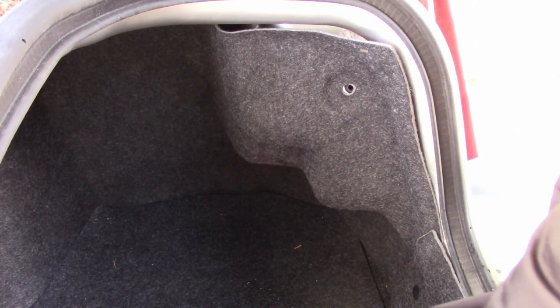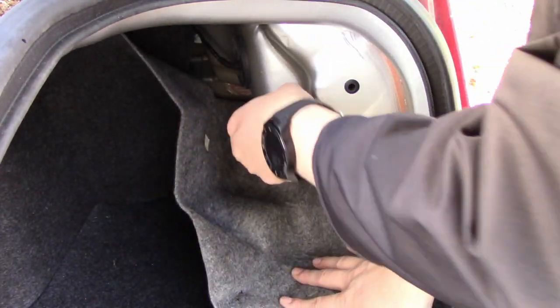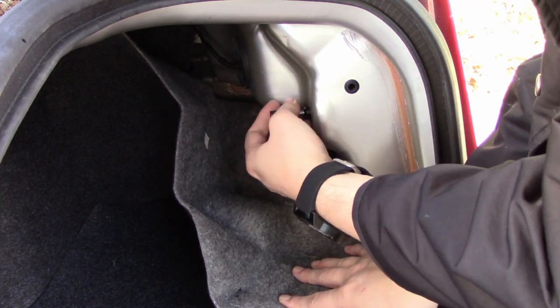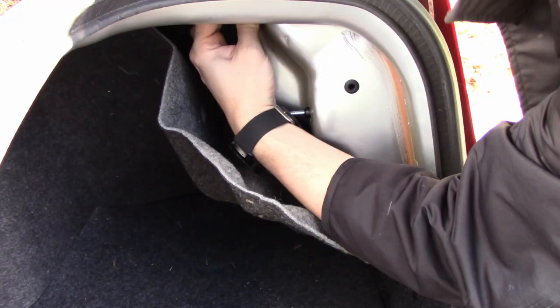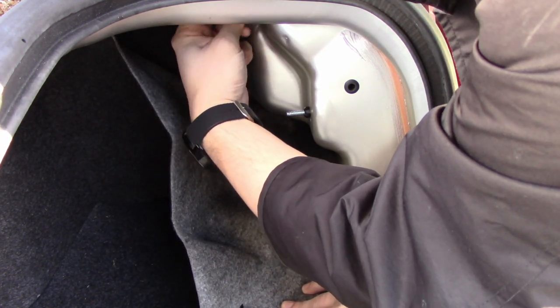That being said, locate and loosen the plastic wing nuts behind the lights. Sometimes there might be a cover over the wing nuts and may be fastened with these plastic pegs. Just pop them out with a screwdriver or by hand and put them to a side. Once the plastic wing nuts are removed, you will need a tool to pry the light out. This may be difficult because there might be a silver ball joint on the right side that holds the light in the correct position but will pop out once pried.